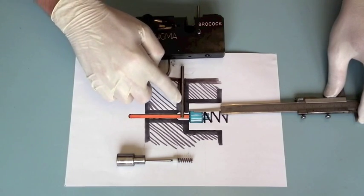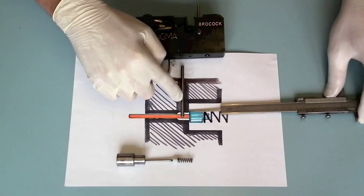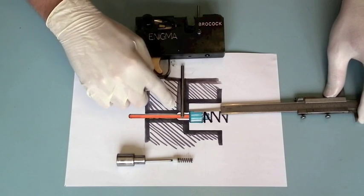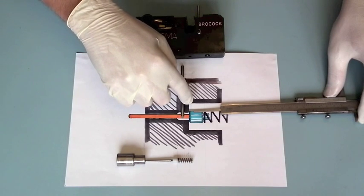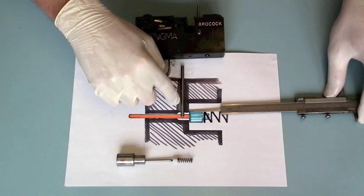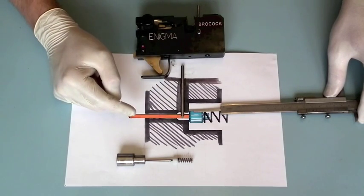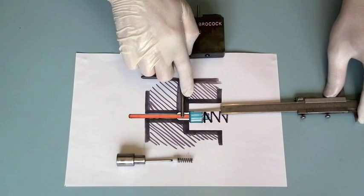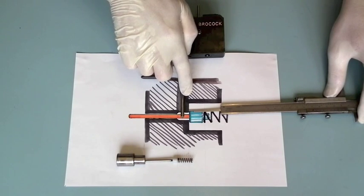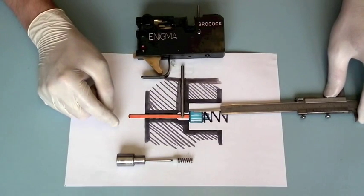So remember, if you're going, say, from a 2mm transfer port hole to a 4mm transfer port hole, that's 1mm per side. Obviously it's not 2mm on this side, so you divide the up size in drill size by 2, and then work out whether the wall thickness is thick enough. This wall thickness here needs to be at the thinnest, I would say 1.5mm thick, and that should withstand all the pressure in here and the flow of the air passing around it.